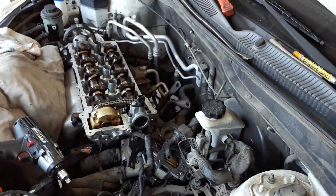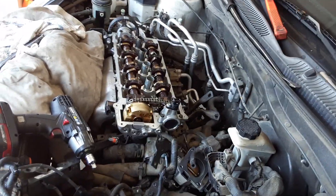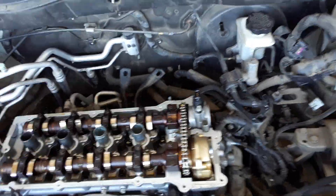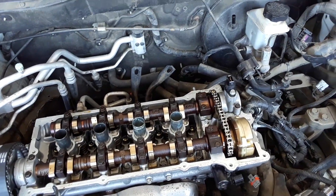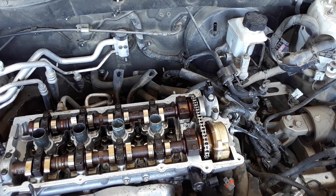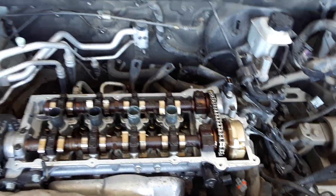Now I'll put this back together — I'm not going to show that. I just wanted to verify that all my timing was correct. You will see a little bit different later: I will start putting yellow marks on all the bolts that have been torqued, so that I know they have all been torqued and they will be marked saying that they are torqued.